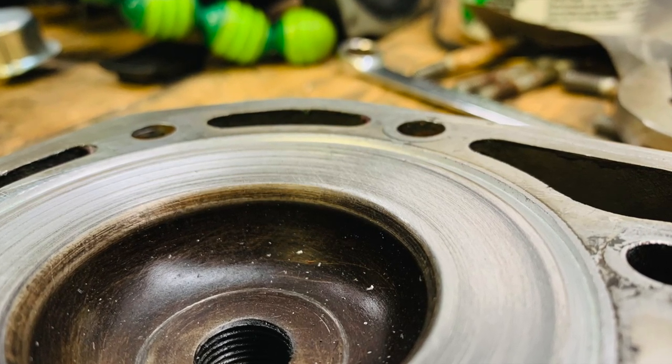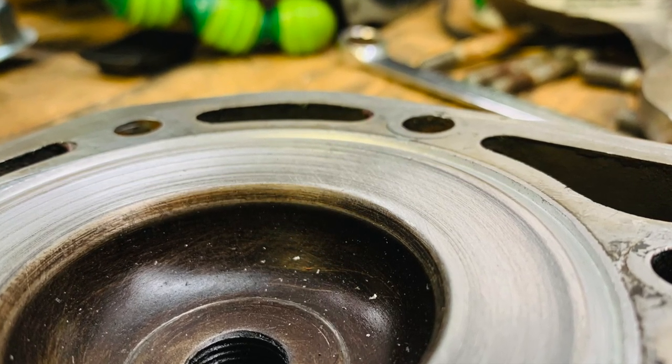Some of you may have noticed that the o-ring groove wasn't cut the normal way — it wasn't cut perfectly round like a half circle. This was actually done on purpose. If you look at this photo, you will see that there is actually a shoulder on the outside and a ramp that leads in towards the combustion chamber. The reason for this is that the combustion pressure will actually force the o-ring to seat into place. If it were a rounded groove, there is a chance that it would try to roll out of the groove under pressure. With the copper, it works out perfectly.